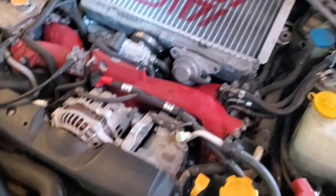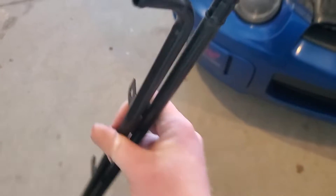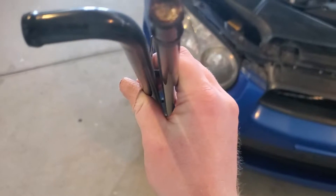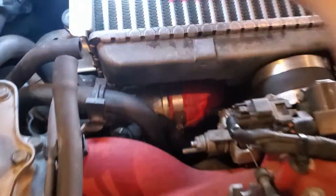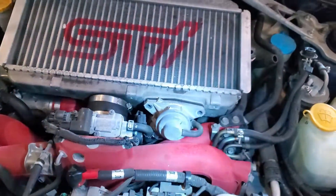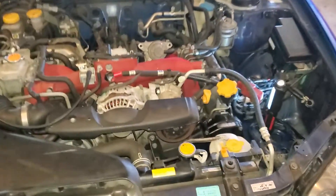I'm taking the intercooler off — it's almost off, really just have to loosen the hose. One thing that kind of startled me is that the other line does not have it. I know that's normal. I pushed it in and it did have a blow-through. I rushed to the forums to see if it's common on these cars, and it is absolutely common for Subarus, especially if there's a suspected leak. I'm going to inspect the hoses and see if there's air or moisture getting in, because that's just moisture and oil building up together and not condensing properly.